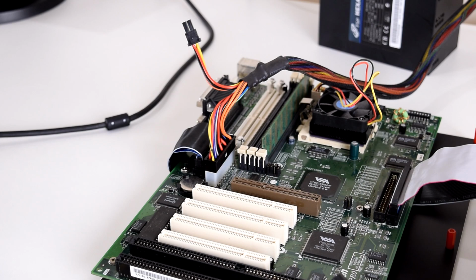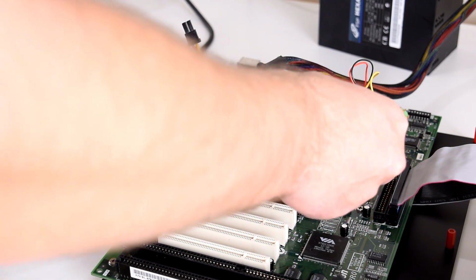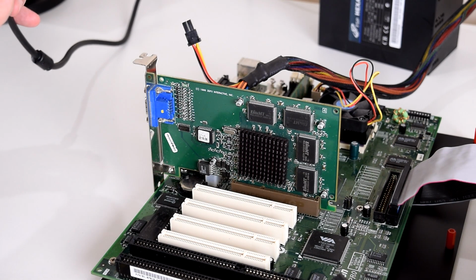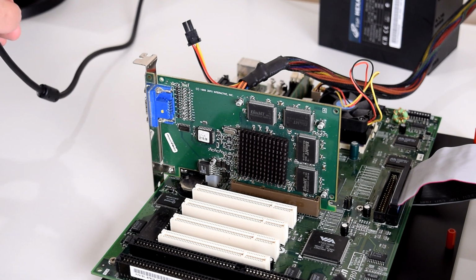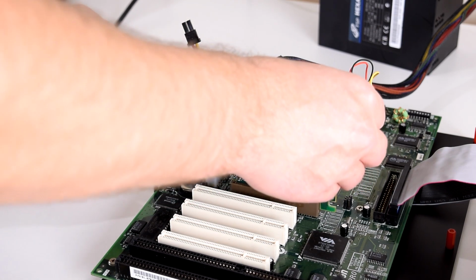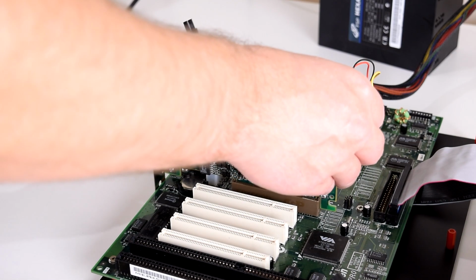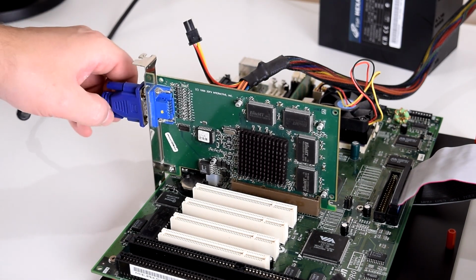The first 3DFX card we're gonna use is the Velocity 100. This card is basically on the level of a Voodoo 3 2000 and will answer the question whether or not it actually makes sense to get something faster than a Voodoo 3 2000. Now, by default, the one TMU is disabled for OpenGL, but if you install the latest Voodoo 3 driver, that TMU will actually be enabled.